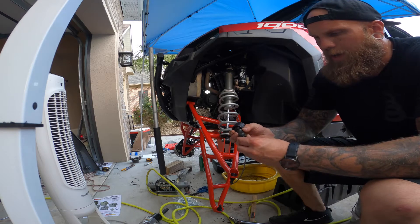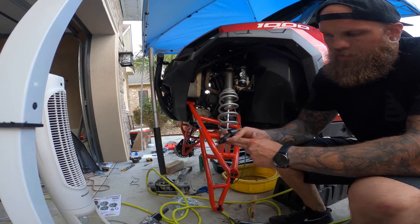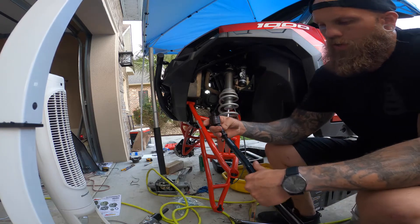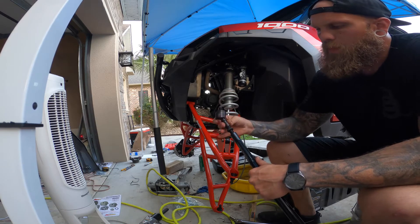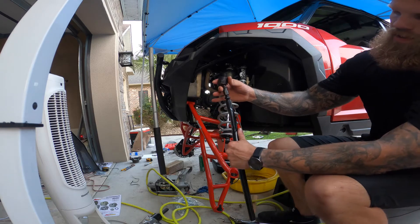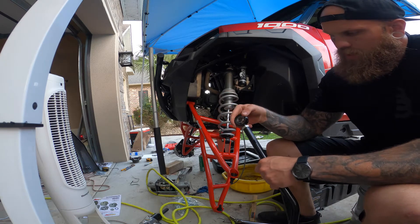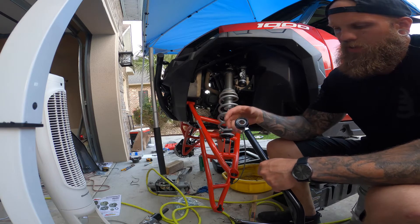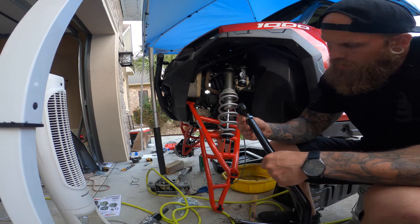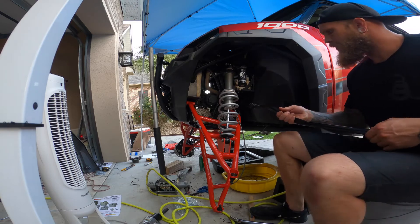This is part of your tie rod and this is what goes to the rack. What I did on the other side: I hid about 3/8ths of an inch of thread. You want your thread to go to your tie rod because that's your adjustment right there. I threaded it in and kind of just centered it, so you've got about maybe an inch of play right there. I loosened this one about the same — match them, it'll make your adjustments easier. About an inch. Center your nut so you have the adjustment. You can count your threads — I got four threads there and four threads there.